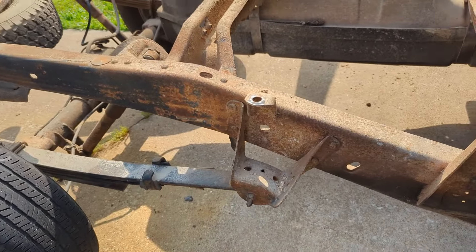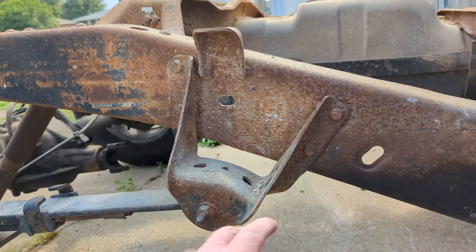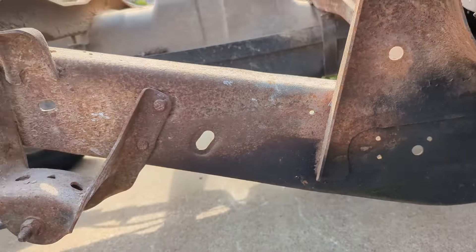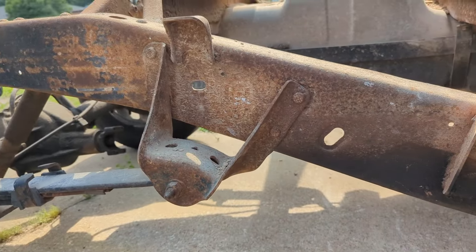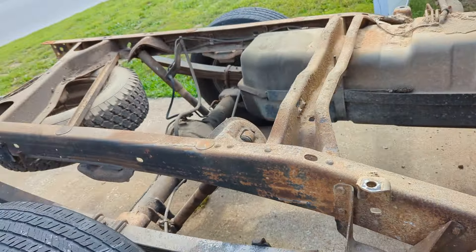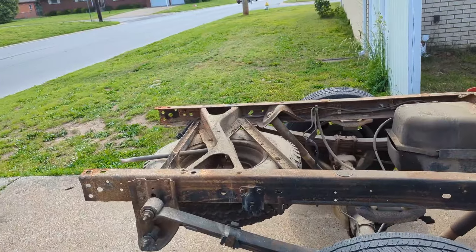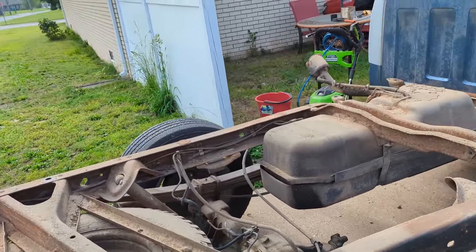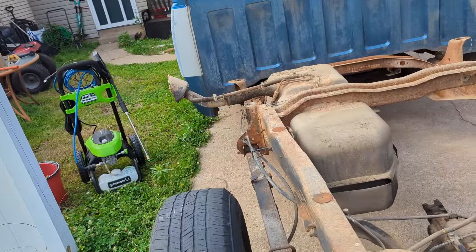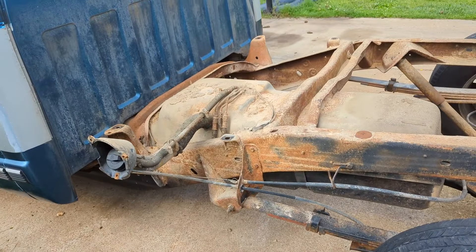What we'll be doing is I got some two-inch drop front leaf spring hangers. I'll take these off and put the drop hangers here. Moving everything forward is actually going to raise the back of the truck up, but I also have four-inch lowering springs, so I'm thinking when I'm done everything should be right. I do have a short bed gas tank. There are a lot of videos on YouTube of this, so I'm not the first one to do it — just first time I'm doing it.